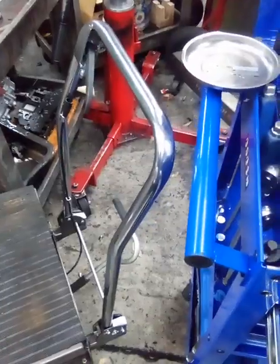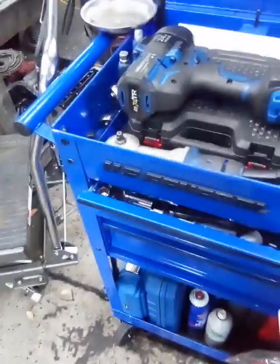You can't unplug the injector connectors every time and expect your Noid light to light up like that. It's better just to back probe the whole circuit and check it that way. And then, of course, maybe ramp your coil if you know what that is and all that good stuff.